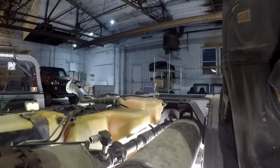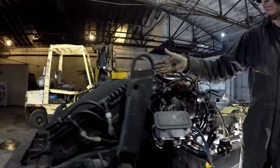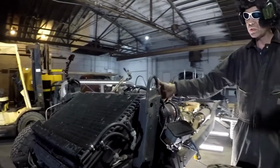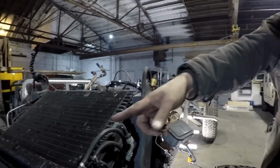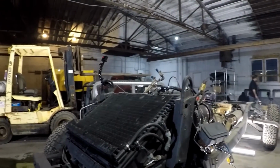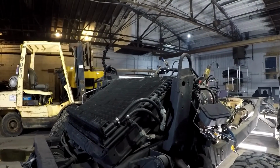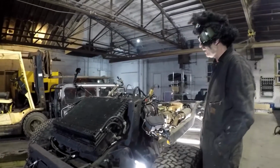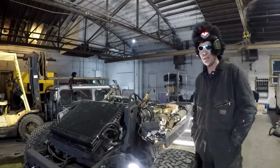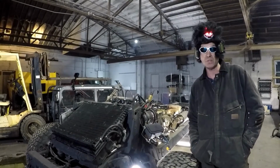But let's see, up front here, this cooling pack has seen its day. Just get rid of it. A couple of horizontal bracket bolts either side and one main bolt. Get that whole thing off of there. You will reuse the fan shroud on it, believe it or not, even though the fan that comes in the kit is bigger. It doesn't sit in the fan shroud. That's one of the things that makes this cooling package that Hline offers so good.